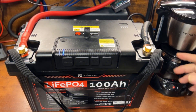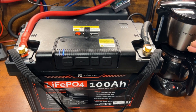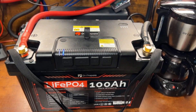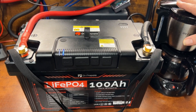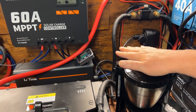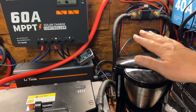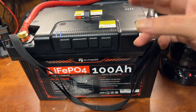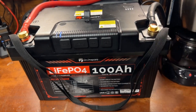One thing I wanted to talk about: I have here my 12-volt coffee pot. This coffee pot requires 170 watts, which is more than a 10-amp cigarette lighter adapter can handle in most vehicles or power stations — even my really large power station can't power it. I have mine wired in with its own fuse and heavier gauge wire. If you're planning to use this battery to power something via the cigarette lighter adapter, make sure that item does not take more than 10 amps.